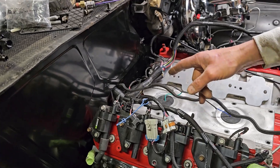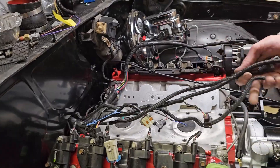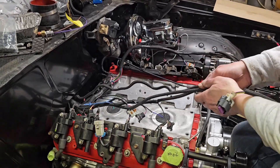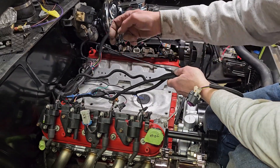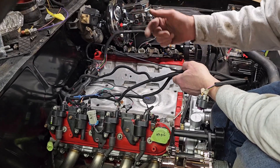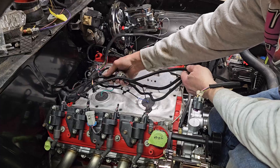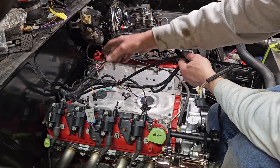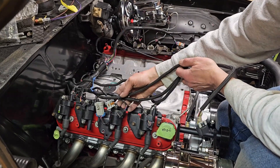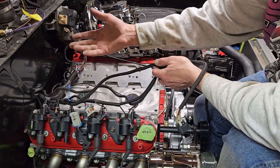So that's an inch and a half hole and I have a grommet that I fed over all of these wires and brought back inside the firewall. Once I get these wires out here I can push the grommet through and then glue it in and seal that off with some silicone. That way if you ever get an oil leak or a valve cover leak where it drips down on the exhaust, it's not pulling those fumes up into the car.